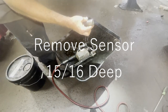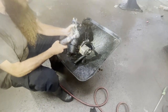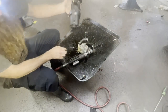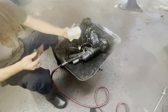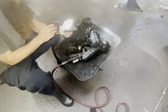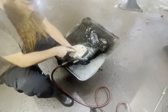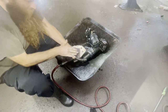Alright, it looks like it's a 15/16s. Make sure your sealing washer stays on there. Alright, this is junk now. We can get our new one and put this back on there. When you take something off you want to make sure that mating surfaces are clean from debris so it seals good. I normally use Scotch-Brite pads because they just don't mess everything up. If you use a surfacing disc you can wear too much aluminum away real fast — all you gotta do is clean that stuff off and you're in good shape.